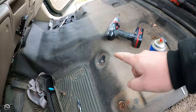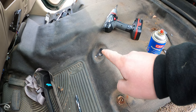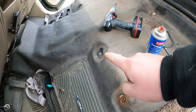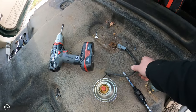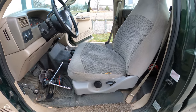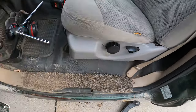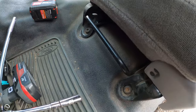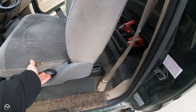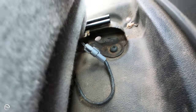Update: I took the grommet out — that was a drilled hole but it was not tapped, so I tapped it and she's good to go now. The seat belt connector wasn't the same, so I just cut the one off the old seat and spliced it into the new seat — should be good to go. This seat is officially in and working as it should. Got her bolted up to the front, same thing with the back, then I got the seat belt plugged in.